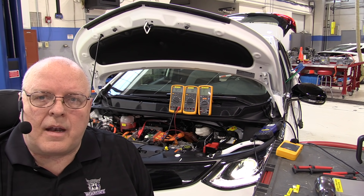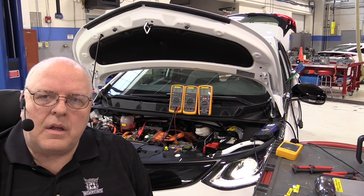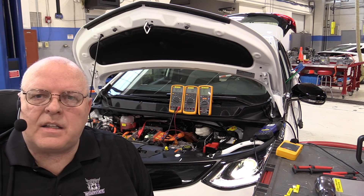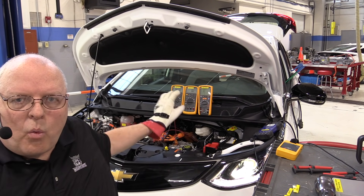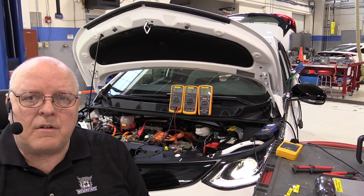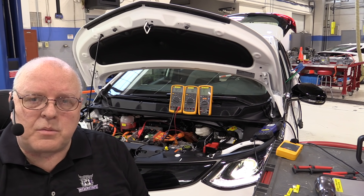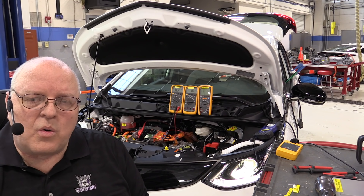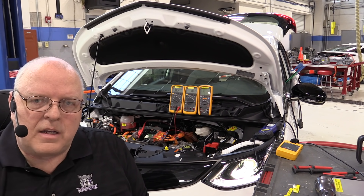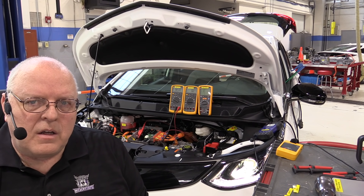There are other situations that can cause loss of isolation differently than a direct short circuit. For example, if water or coolant leaked inside the battery, or got inside any of the high voltage electronics — water can be conductive, antifreeze can be conductive, the air conditioning compressor refrigerant oil can be conductive, and transmission fluid can be conductive under certain situations. If the wrong fluids have been put in the vehicle or there's a fluid leak that allows intrusion into these electronics, we would see a different situation.